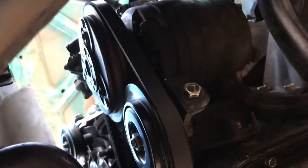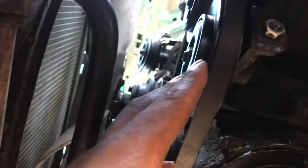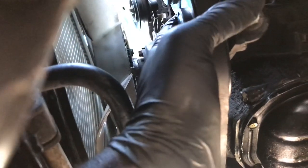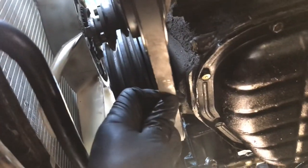The AC belt is on, but I strongly recommend you get the pulley off first — just take it off, wrap the belt around the compressor, wrap it around the crankshaft, then take the pulley off, push it up, wrap the belt around it and it'll go into place. Then stretch it back down. Once your belt is on around the shaft and everything, pull the tensioner towards you and tighten it to get the belt nice and tight — not super tight where it can't move, but enough that it runs smoothly. Then tighten up your pulley bolt.